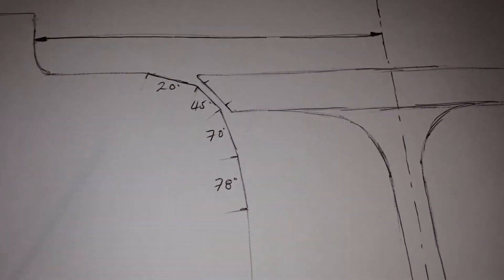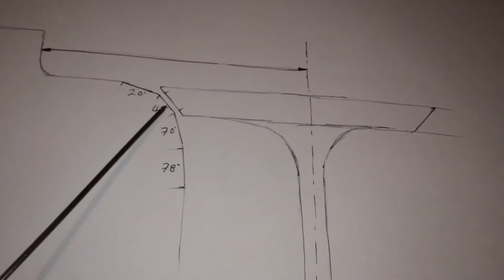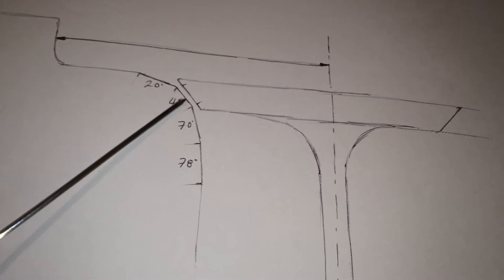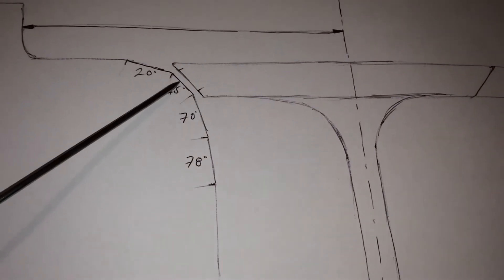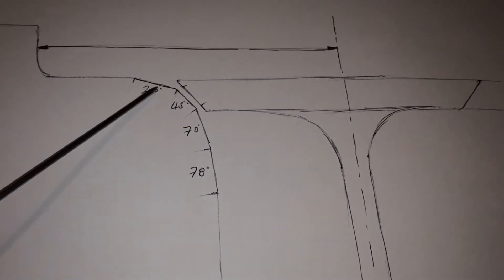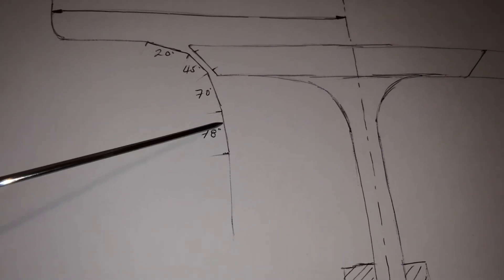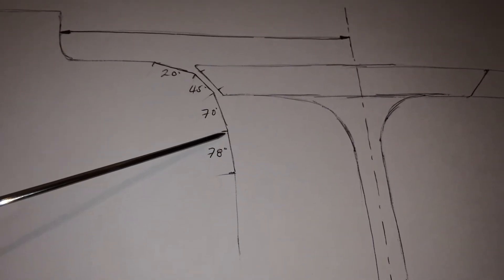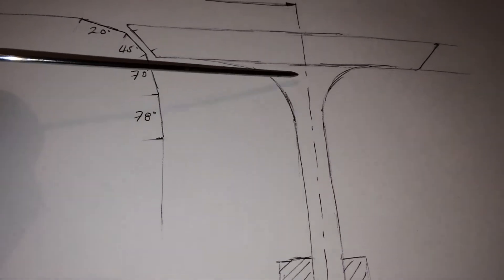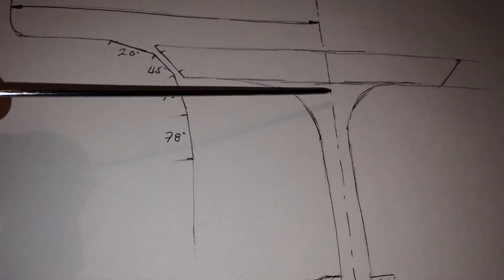It's fairly important that we've got a basic understanding. Looking at our valve and valve seat: this section of the valve is the valve face, and the section it seals on in the cylinder head is the valve seat. Our valve seat is generally speaking a 45 or 46 degree angle, a bottom cut at 70, and a top cut at 20, or traditionally 30 or 35 degrees. These three angles have been cut using the guide as a centre.